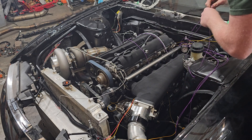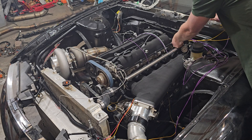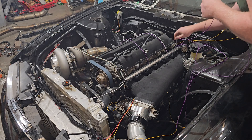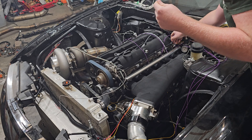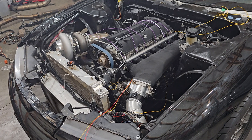Injector six — and now injector six, since it is actually right there on the end, I like to give a little bit of slack for this one also, so that way the harness can kind of stick down and tuck down a little bit because I like to move my injectors around.